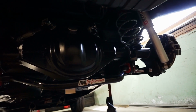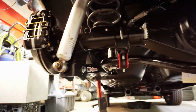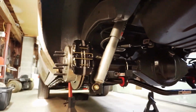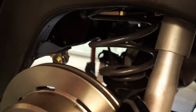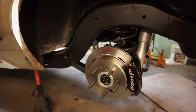Like I said, it wasn't too bad, 4 hours by myself. It's also not that hard when you've got the Roto-Joints on the control arms and then the adjustable uppers. It gives you a lot more freedom and flexibility to move stuff around. So I just got to add some gear oil and do up the brake lines. I also got to get a new measurement for a drive shaft, and then my driveline's going to be all set, at least from the transmission back.